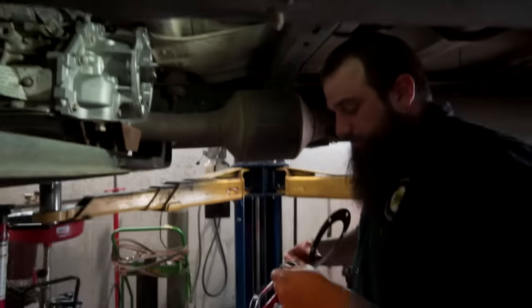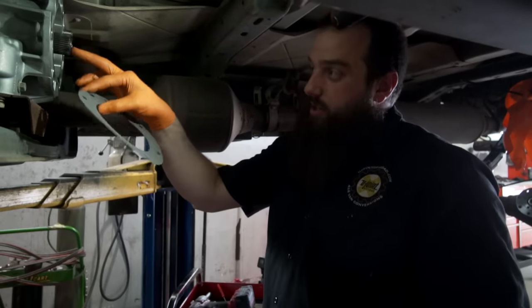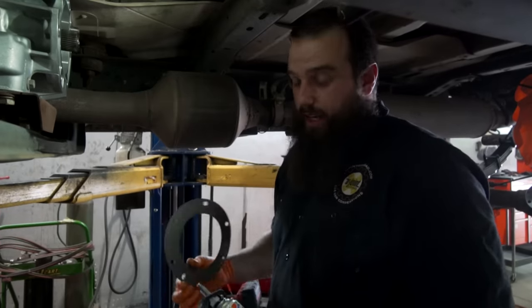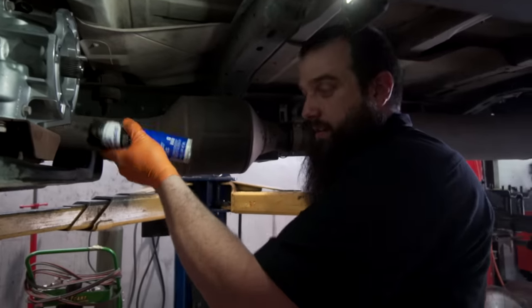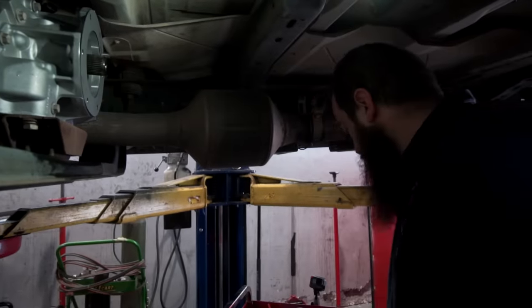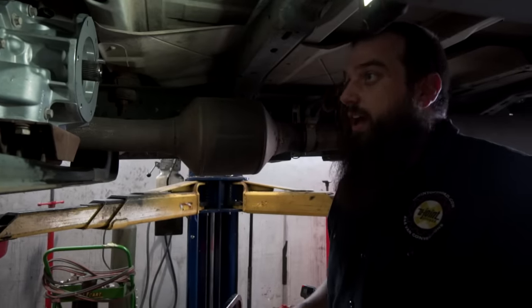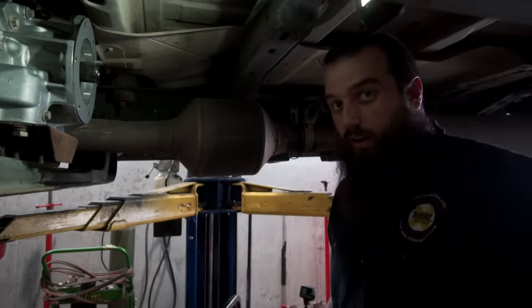Tell me what you've done so far. On the 5R110s all we have to do is change the output shaft and the tail housing to adapt the T-case, and you can do that all with the transmission still in the vehicle. That makes it really nice and simple. Looking forward, we are going to put the T-case up in just a minute, make sure it's all bolted down nice and tight, and then we'll check our driveshaft dimensions to make sure they fit, and then start on the four-wheel drive shifter and getting those cut and ready to go.